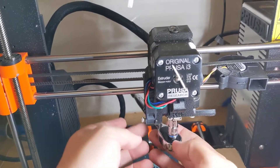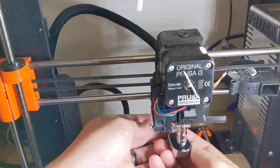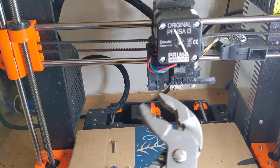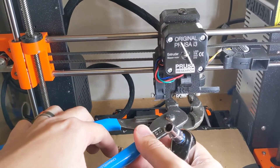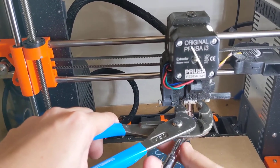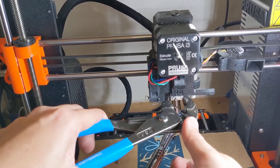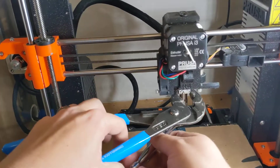We're going to go — it's going to appear to go counterclockwise, but relative to the nozzle, it's tightening it. There we go — I can just feel finger pressure. At this point, I'm going to bring back my channel lock plier to secure the heater block. We're going to apply about one finger's worth of pressure. That's it — you don't need much. Just one finger of pressure.